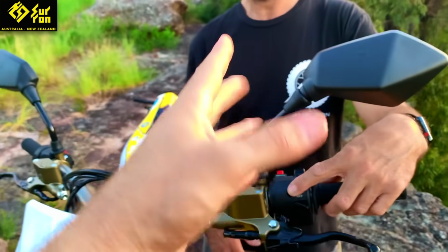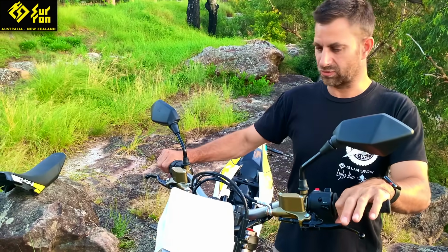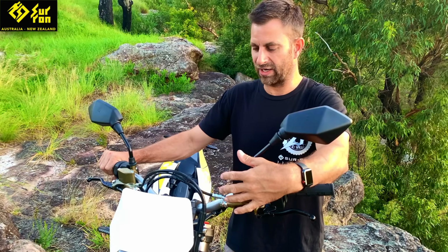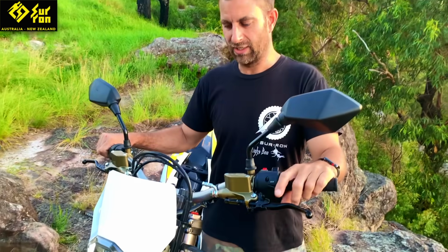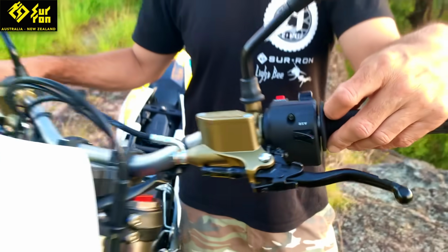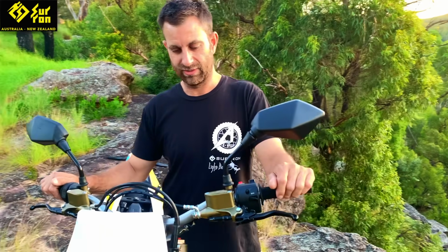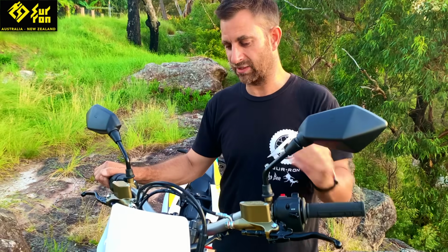Just tell your experience, like when you're accelerating the bike and it feels weird, like the throttle's cutting out. I thought at first you had a faulty throttle. I thought maybe I was resting my fingers on the brakes, because the brake switches can activate the throttle cut as well, so I made sure I was riding clear of those, but the throttle was still a bit jerky. I turned off the ASR, which is active spin reduction, and that seemed to fix it. So possibly the tire sizes, or one wheel thought it was spinning faster than the other and it was implementing some sort of safety. I tried to go on gravel here, just braking traction, and you can feel it's kind of like an ABS, but on throttle.